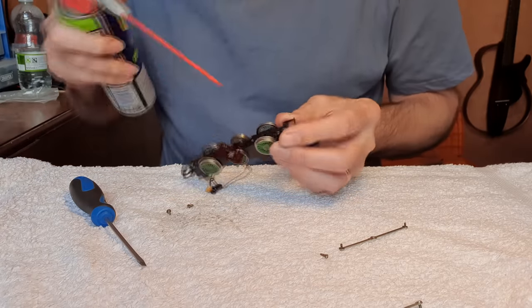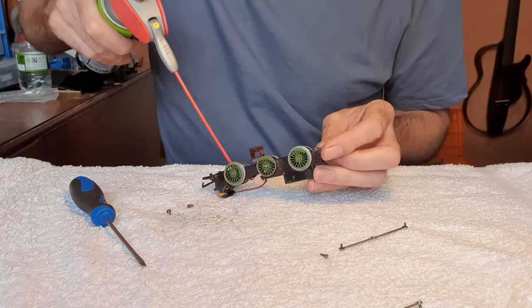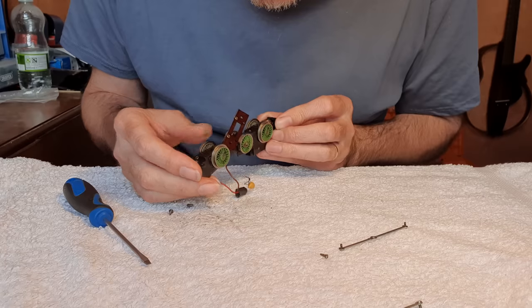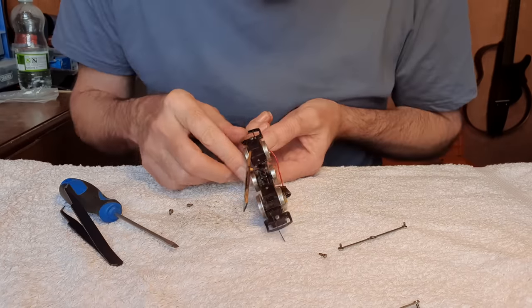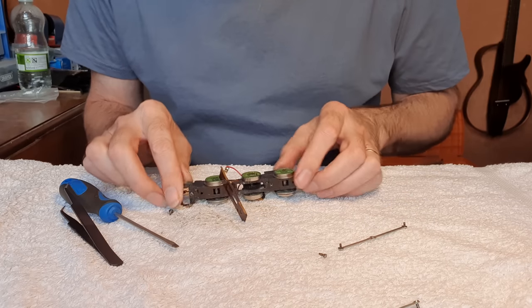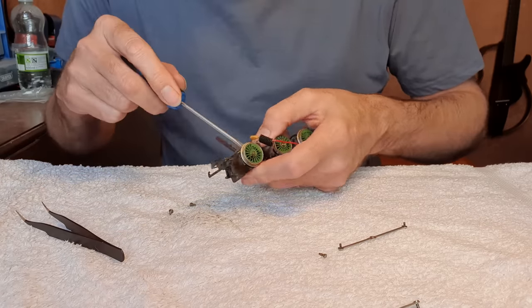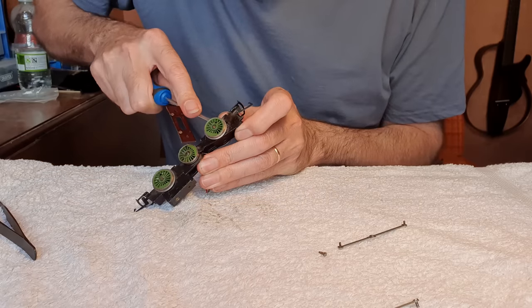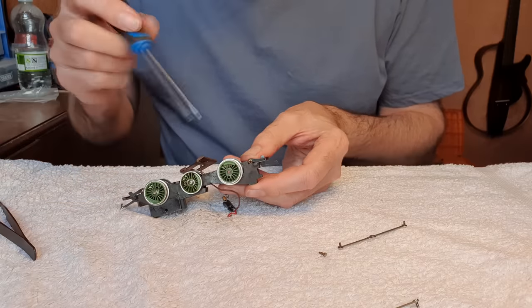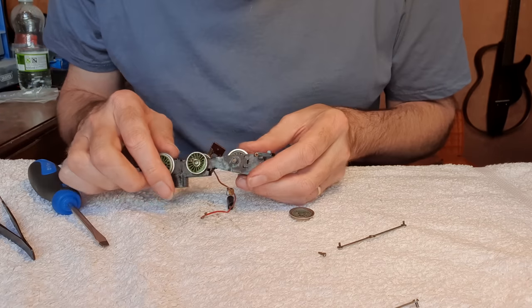Hopefully the faithful contact cleaner will free these up. This one's not playing ball — there's hard gunk caked around it. I think I'm going to pull this wheel; there's fluff and goodness knows what else caught up in there. I'll try a bigger screwdriver. There we go — unfortunately the plastic bush is still there, but let's pull this out. A little gunk in there but that's it out — tiny bits of wire and all sorts of stuff got up in the wheel.